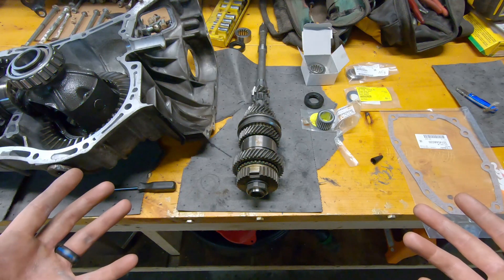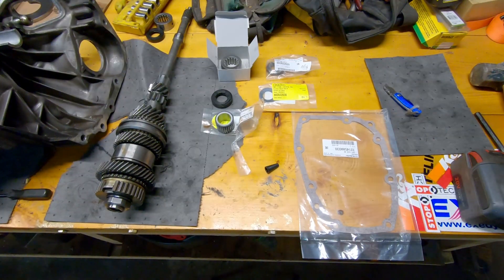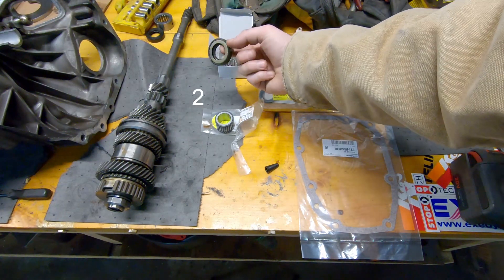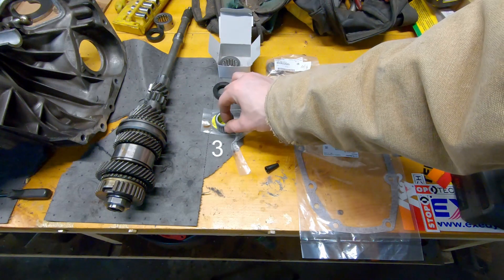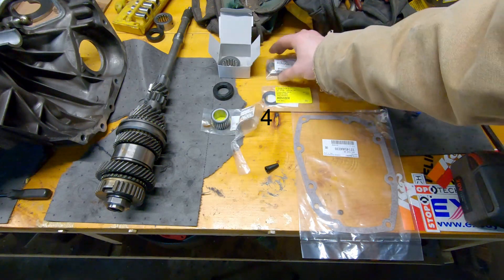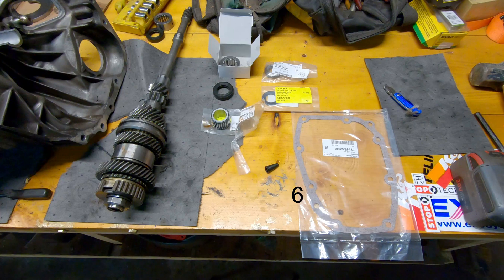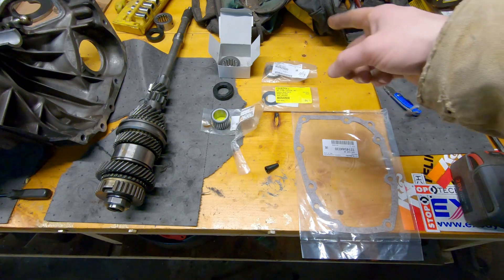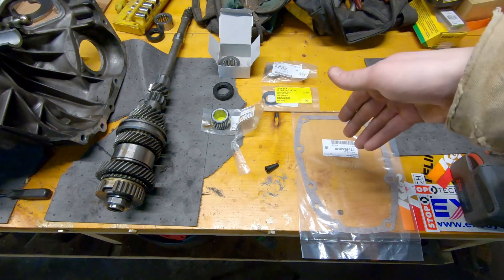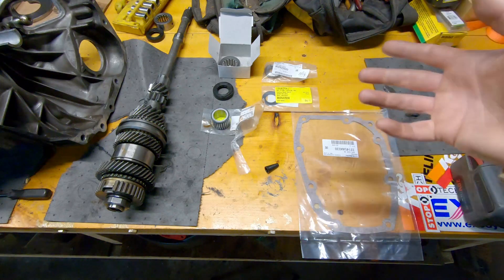So let's go ahead and get everything together, and at the end of this video we'll have a fully assembled transmission. All of our parts came in: we have the new bearing for the end of the input shaft, the new seal for the end of the input shaft, the roller bearing for the fifth gear assembly, the locking washer and nut for the end of the input shaft, and a new gasket for the extension housing. I'll leave part numbers down in the description corresponding to each part I pointed to, so hopefully I can save you some time if you're doing this same sort of project.